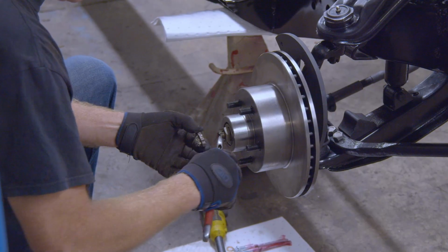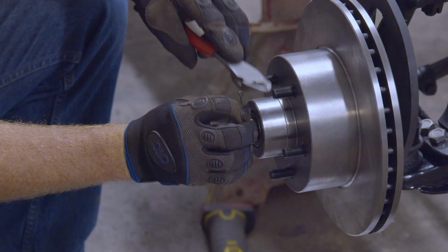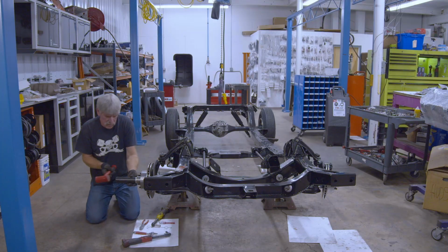I really felt like the disc brakes were important when you consider the fact they say a front brake on a vehicle does about 70% of the stopping. That's a lot to be putting on a pair of shoes, old shoes with adjusters that aren't automatic and they just flip around and lock up and try to kill some poor driver going down the road.